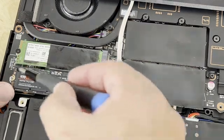For the mode, pick Beginner. On the next menu, pick Disk to Local Disk, which is the cloning method we want. Next, pick the source drive — pay close attention here and pick the 512 gigabyte smaller drive. Then pick the target drive — this is where the data is going to move to. We're given an option to run a check and repair on the source file system; we can skip that.